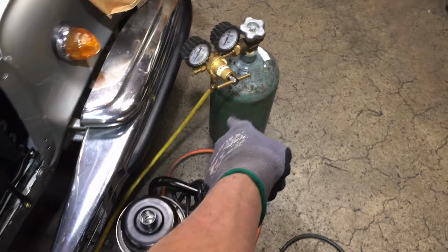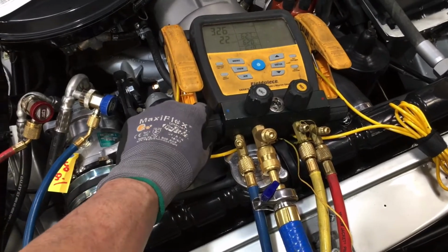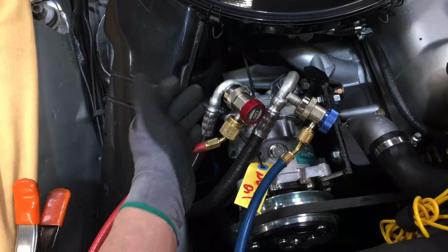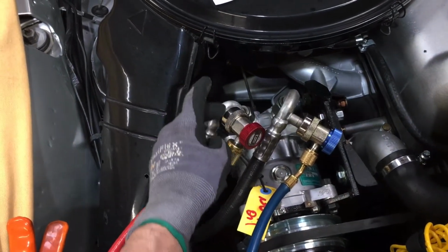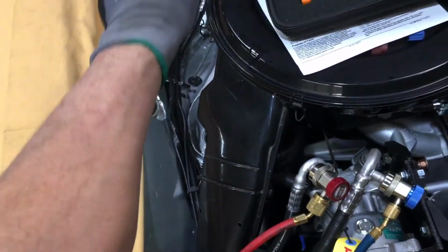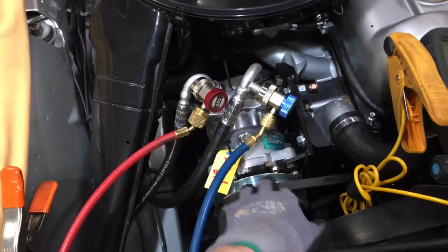So in this case, we will be taking the high pressure nitrogen, sweeping through this valve, through the manifold. The low side is shut off. The nitrogen will be flowing down the high side hose. It'll go into the high side fitting. Now on this particular vehicle, we're really lucky because it's actually located at the compressor. Some of them are located in the liquid line going by the expansion valve. So you would have a two-way flow going towards the expansion valve and going back to the condenser, through the receiver dryer, and then back up to the compressor. But this is the optimal, best way when you're so lucky.